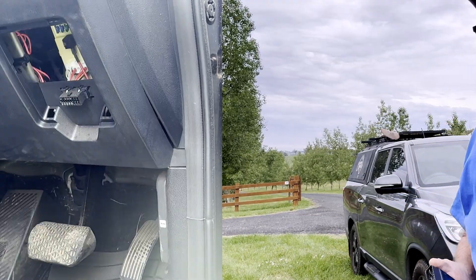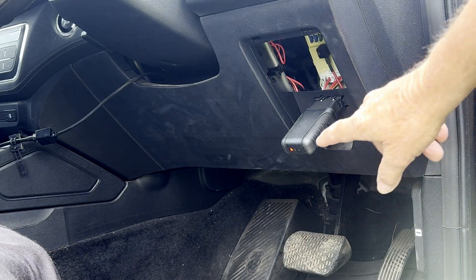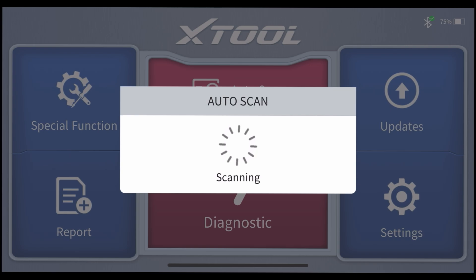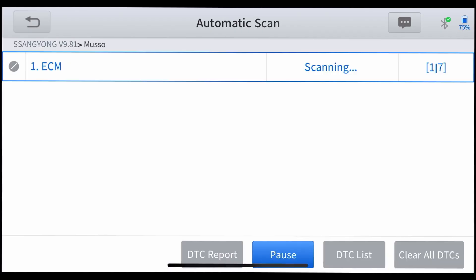This is bloody exciting, isn't it? Now, here we are. Just get your little OBD, find it — you can hear it locking in, and there we go. A little red light on the bottom here to tell you it's connected. What we need to do now is just hook it up to the phone — that light will go green, and I'll show you what's on the screen. So I've got it plugged in, turn the vehicle on. What we're going to do now, we're just going to do an automatic scan to make sure things are right. She's running through. It tells me I'm Ssangyong. I need my Musso, so we press Musso. I'll do an automatic scan and if you look in the top line there, it'll tell you what it's doing. It's scanning, and it's doing one of seven, two of seven now, with the automatic scan. Running through the systems to ensure everything is okay.